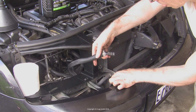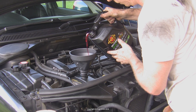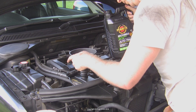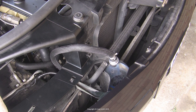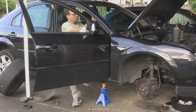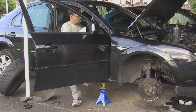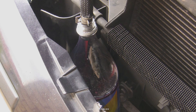Since I'm doing a flush, the return hose needs to be stuck in a container — I stopped up the reservoir side of that joint. Fill the reservoir with new fluid and then crank the engine to run the pump slowly. Because I disconnected the camshaft sensor, the engine won't fire, so I'm basically using the starter motor to run the pump. You also need to turn the wheels lock to lock, which will flush out and bleed the steering rack — this is the other reason you need both front wheels off the ground. Do this a few times and you'll start getting fluid out the return hose. My old fluid was green and the new Mercon V is cherry red, so it's obvious when the old stuff is gone. The system doesn't hold much fluid — a full flush is done by the time you've filled a soft drink bottle.